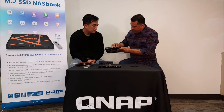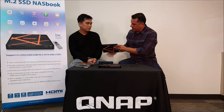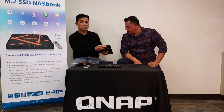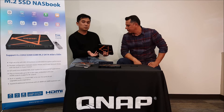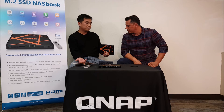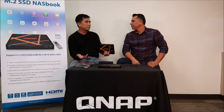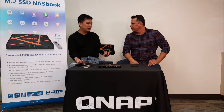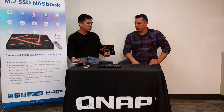What else do we have here? I think there are some USBs and some HDMI. We support USB 3.0, so the transfer speed will be very fast. You can connect to multiple different applications such as a USB camera for video surveillance, or you can connect to a UPS. We also support USB expansion — for example, you can connect to another unit like a 5-bay or 8-bay. We call it the adjunct function of disk device.